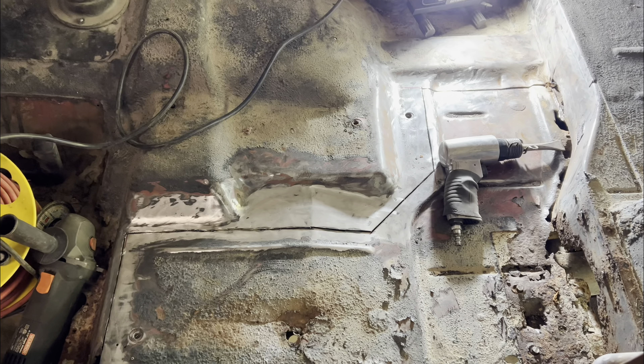I got this scab part welded in and the weld ground back. I didn't try to fill in between every one of the welds because I had an area that blew through back here — I wasn't able to get my little copper backer in there behind it. The metal was kind of thin anyway back in here. So I decided to fiberglass over it with cloth and resin, and that'll create a watertight seal. It's stuff made for boats so I know it'll work here. Then I'll sand that lightly and put some short strand fiberglass over top just to smooth and contour it.